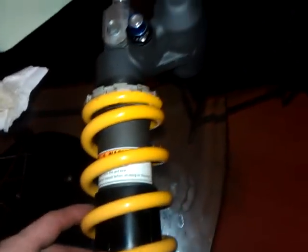I'll be fitting this weekend. It's almost a direct fit on your Mark 1 Bandit. Because of the nitrogen reservoir, you're going to have to move a bit of your battery box for it to fit. And where your dog bones fit, you'll need to put a few washers in to space them out a bit so they don't catch the spring, because the spring is actually a bit wider than the standard shock. But it's almost a direct replacement fit and you'll really notice the benefit when it's done. It's a K8 GSX-R shock.